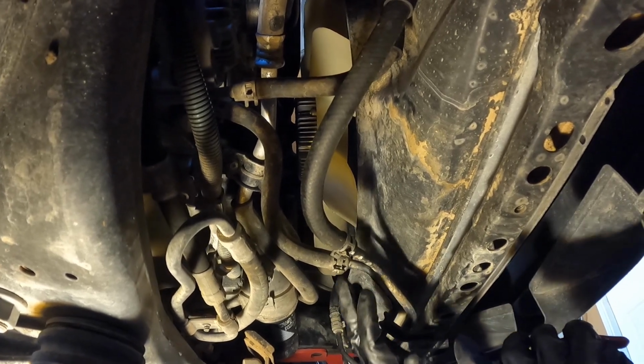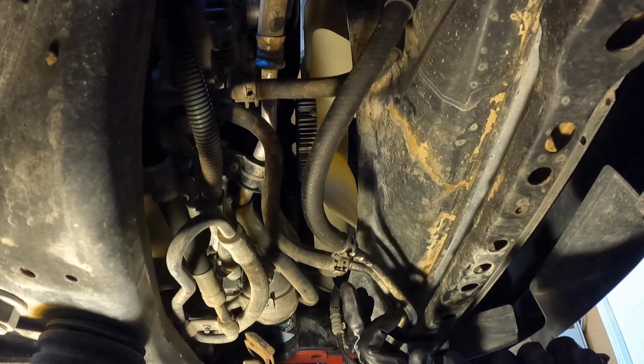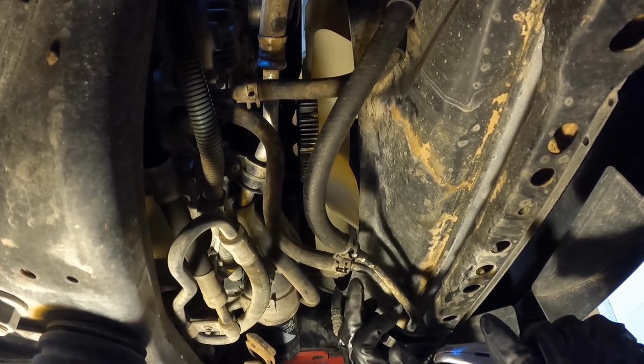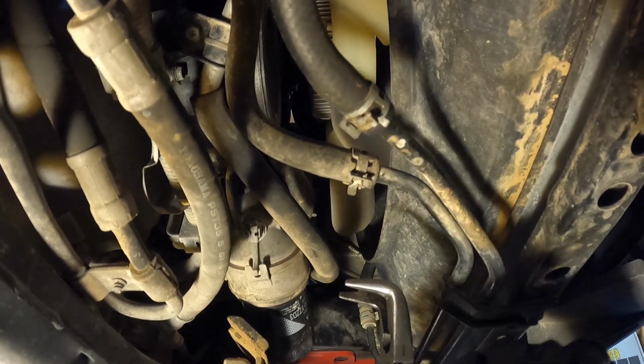So that's a down and dirty of how this transmission cooler system works. And so what we're gonna do is we're gonna disconnect this return rubber line off of this metal line, and we're gonna hook up a 3/8 inch transmission hose in place of it and direct that hose into the graduated food grade container. These hoses are attached with constant tension clamps.